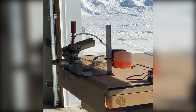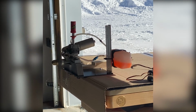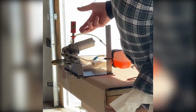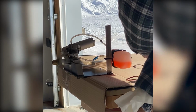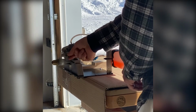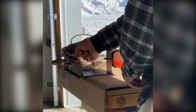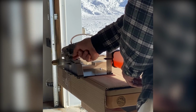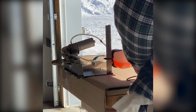If you're not sure if the high-speed needle is set too close to peak or on the lean side, you can do a pinch test where you just quickly pinch the fuel line and let it go. You don't want to kill the engine, but if the engine increases RPM somewhat, you can just tell by the sound, or if you want to use your tach, you can. You know you're still on the rich side. Just give it a slight pinch and let go.